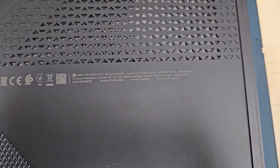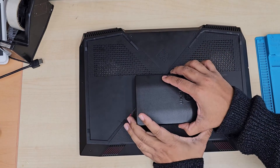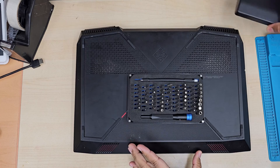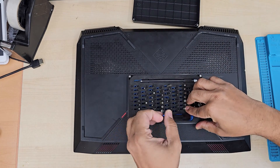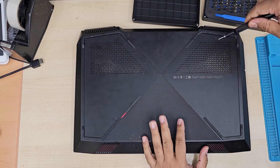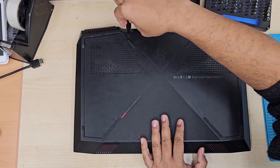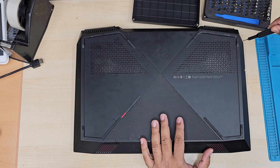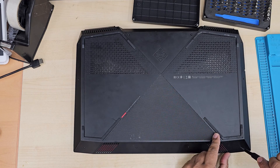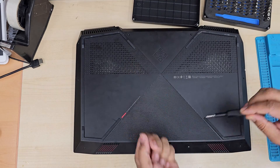The third thing is to follow the safety precautions. Before, you could take the battery out from outside on older laptops, but nowadays almost 99.99% of laptops have an internal battery. So when you try to replace any screen, you need to disconnect the 40-pin display connector, which is compact in size and very easy to get damaged if you don't disconnect the battery first. That could short the motherboard to ground and it would be completely wasted. So the first step in the right procedure to replace the screen is to disconnect the battery — it doesn't matter if it's charged or not. That's why we're going to take out the back cover, and once removed, we're going to disconnect the battery connector first. Then we are good to go.